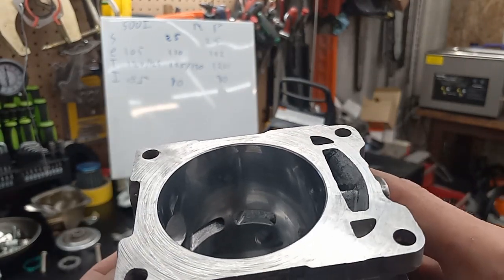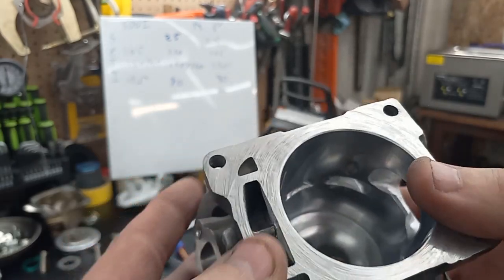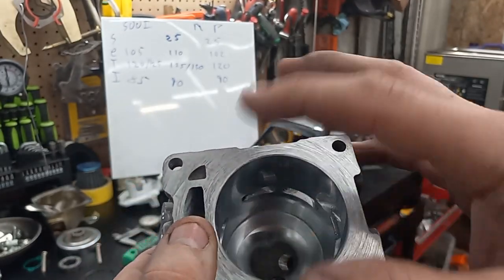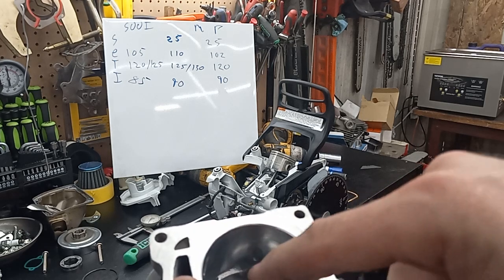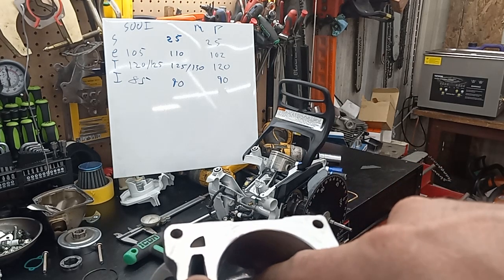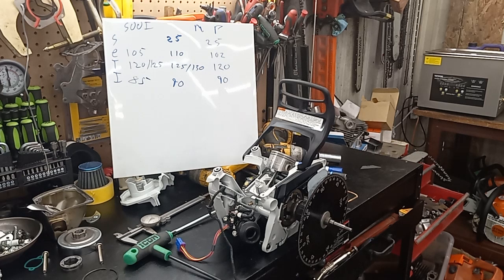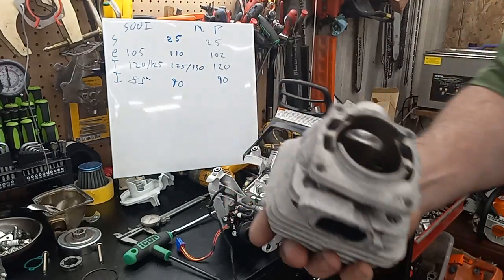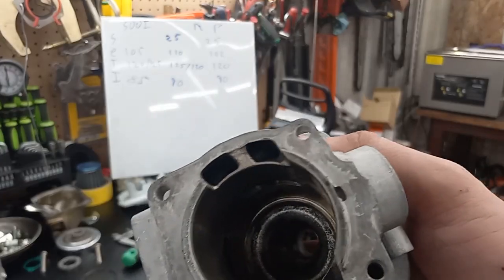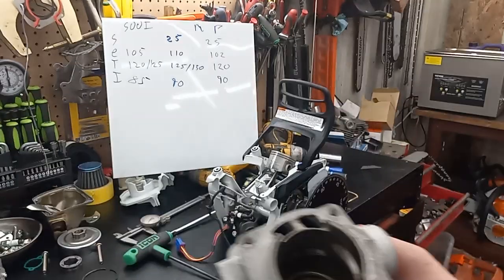Here's the front view — how I tunneled it. There are the uppers — I fired both uppers at the same time on this one. I textured inside here. The reason I call these a compromised transfer is that area right there is feeding the transfers. Comparing to a Husqvarna here — you can see that's got twice the transfer area on one side.